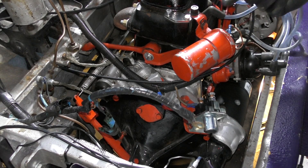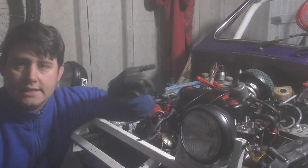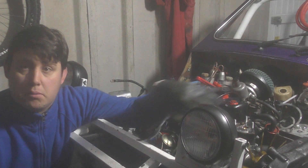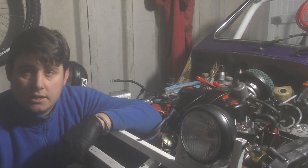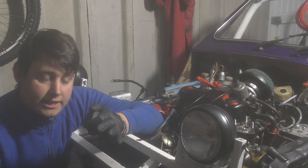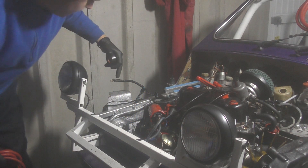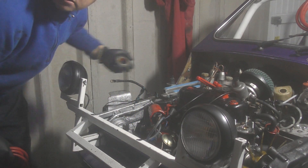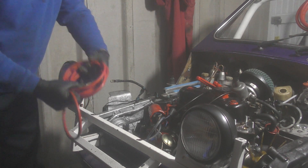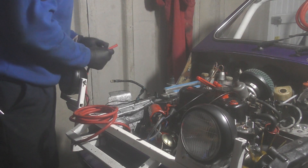This is the interior trim. There are a few screws across the top and I can peel it back to get access to the box section to the side of the car. There are a few bits of this that have to get pulled through some tight gaps, so what I'm going to use is this electrical tape and the new cable. I'm going to tape the new cable to the old cable, and as I pull it through I should hopefully pull it enough so that the new cable gets pulled through and the old cable gets pulled out.